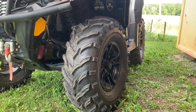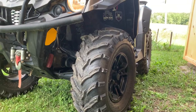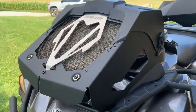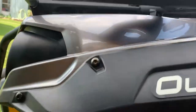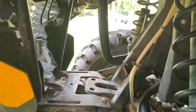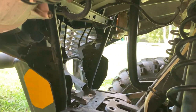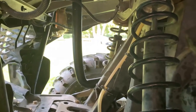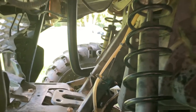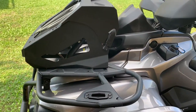A couple of challenges on this machine that I've addressed with accessories: the rad relocate. For some reason on the 570 model they don't have any side panels to protect the rad from mud being splashed up from the tires. I had a few issues going into limp mode after a couple of hours on the trail, so I had the rad relocate installed and I'm looking forward to seeing how that changes things going forward.